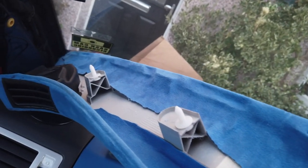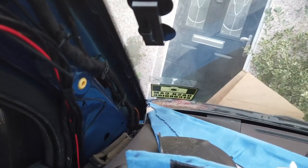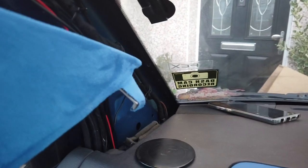So I've pried off the little clips at the back. Once those three are popped off, as you can see, this is what it'll look like. There are wires at the back that run down there. I've also got ultrasonic sensors on mine, so that would have to be disconnected — that little one there. Very straightforward getting it off. There is a funny shape at the back which sort of just fits under the dashboard, so when you're pulling it off be careful. If you get stuck, you know what's holding it — it's that little bit right at the bottom.